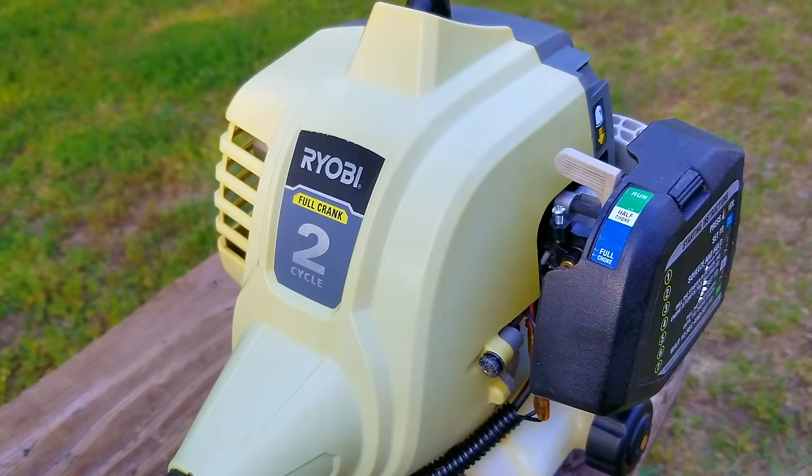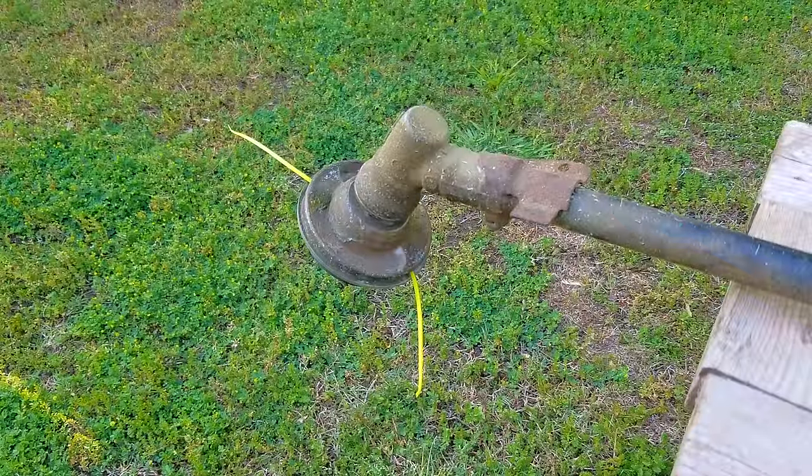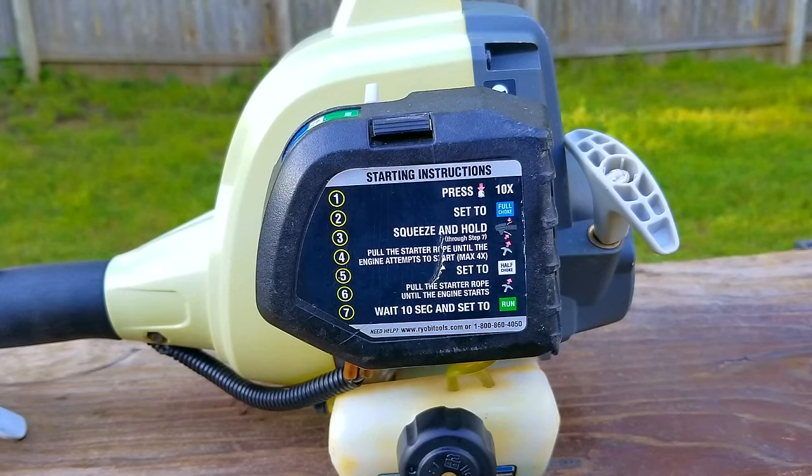The reason I say that is because it would have to get past the fuel filter first and eventually the fine screen in the carb, which I find very impossible to do. However, I can't prove it. The only thing I could think of is that the debris came loose from inside the carb, which makes more sense to me. Now, the inspection process and more than likely the tolerances are not as strict for an aftermarket carb, so I can see how it's at least a possibility.